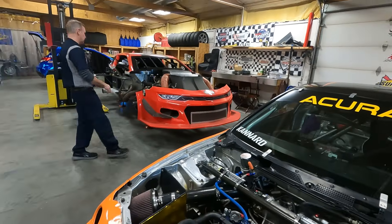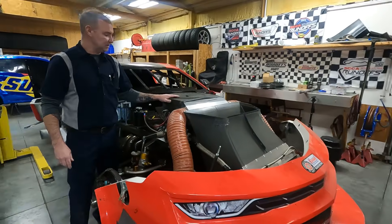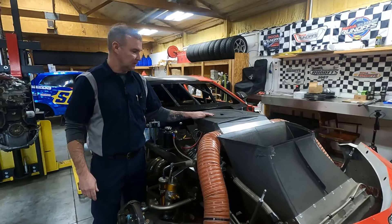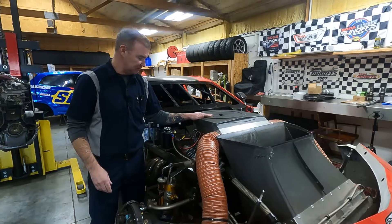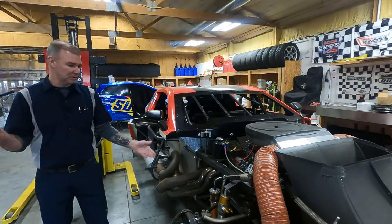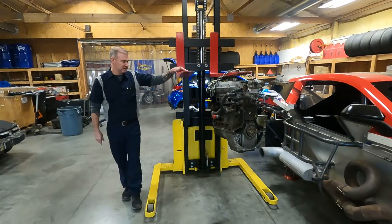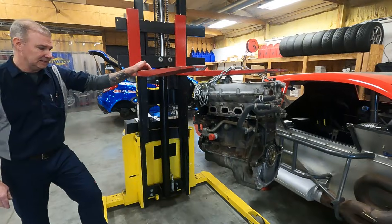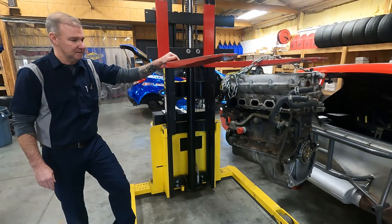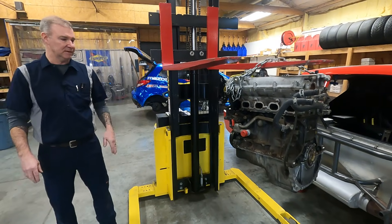I am so glad I did not pull the engine out of the Camaro, because it sounds like we've got more delays when it comes to the new engine. We're probably going to start the season with the older engine. I'll see if I can get Steve to dial her down just a tick so we don't have any issues. Motor runs okay, it's just kind of timed out. Got a beautiful VVT core engine in — this is a street engine for a guy in Kansas City. He reported a knocking inside, so I imagine he's got bearings out. It's going to be a really nice street rebuild. Just came in and I still need to get that apart and get that going.